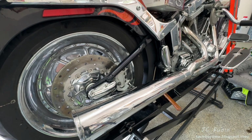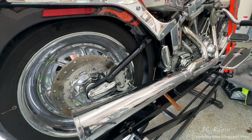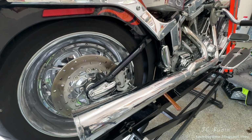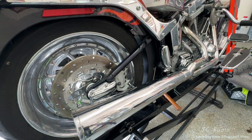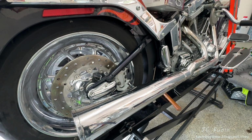I cannot rotate the tire even with the clutch pulled in, even trying to pump it up. So I'll try and pump it up some more. And I spent about 5 minutes doing this, but it's obvious that pumping up the clutch is having no effect. What I need to do is physically examine the clutch to rule out the hydraulics I just worked on.